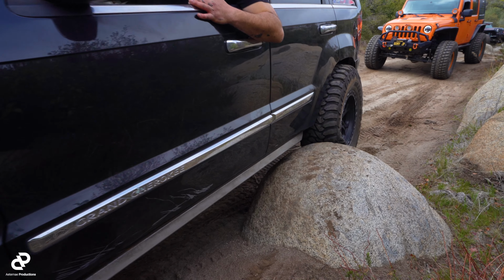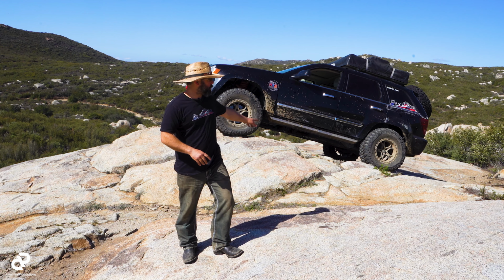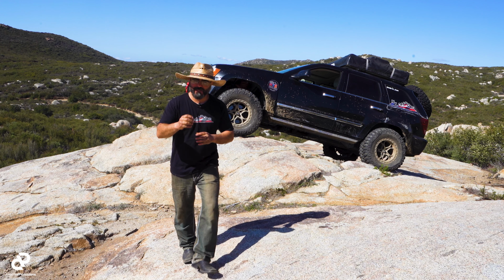We know it's a solid product, because in that case, I'm not worried that you're going to call me telling me that your rock slider fell apart or it dented. That's a 0.188 wall tube, can't dent that. Well, you can if you really wanted to, but it's very difficult.